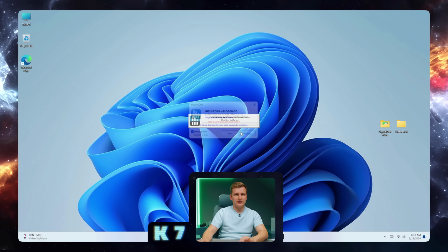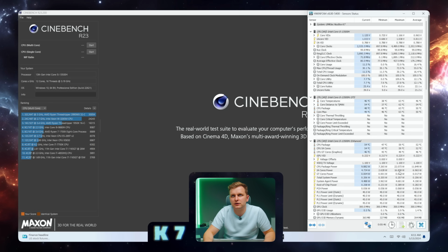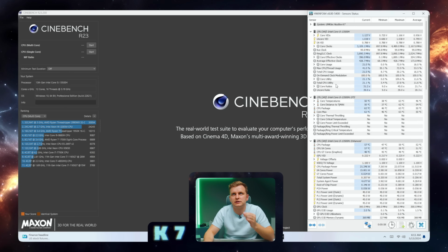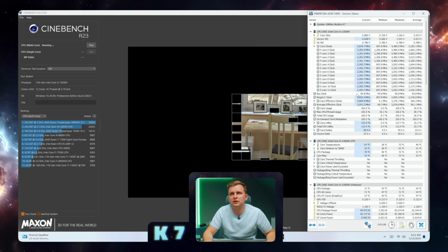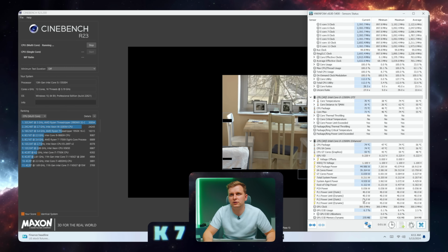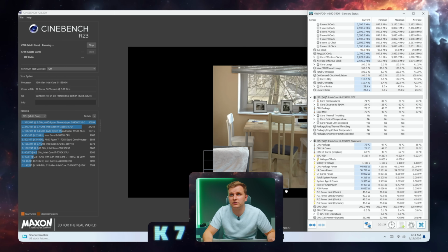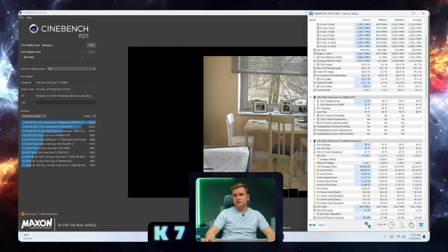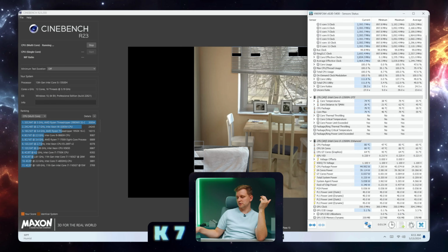When using the device, you instantly feel it's very, very snappy actually. Right now we've peaked at 59 degrees at 22 watts. So let's give this a go and see what happens. P-cores are going 3.3 gigahertz and E-cores 2.6, and we're pushing 45 watts. Our PL1 and PL2 are 40 and 45 watts. 71 degrees, that's not necessarily loads. 72 degrees. I mean, the cooling is pretty all right, but it's only pushing 45 watts, so that's not anything massive.